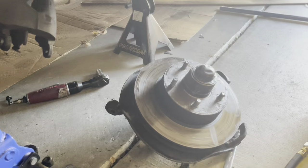Getting ready to put in the BMR lower control arm. Had to go buy new bolts because the stock ones don't fit through these holes. Make sure when you put in the front one, you go from front to rear — that's how the bolt goes on the front. These torque to 90 foot-pounds, so torque them right. This one was actually much easier than the passenger side — I was able to just muscle it in. Then put the bolts in — remember front to back on that one. I'll torque them to 90. And I re-torqued these to make sure they were 73 as per the book.